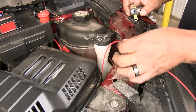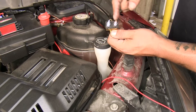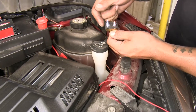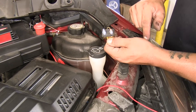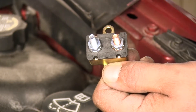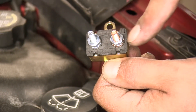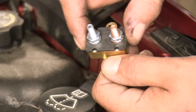With our wire brought up to the top, we're going to need to find a spot to mount our breaker. The breaker is going to have two different posts — one silver and one copper colored. They're going to be labeled: the silver is auxiliary and the copper is labeled battery. Typically you would think to hook the copper post to the battery, but since we're using it to charge our battery, the red wire coming from the front of our vehicle is going to hook to the battery post, and then the silver post is going to go to the battery on our Equinox.